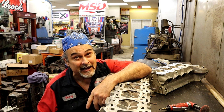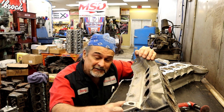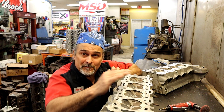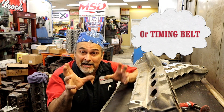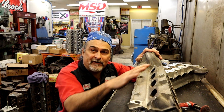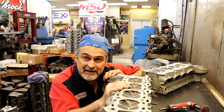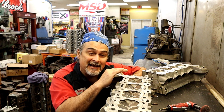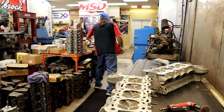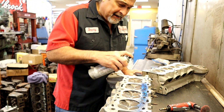This is a dual overhead cam head. There are bucket adjustments in here because it's not hydraulic. The more you cut here affects the top end. It has a chain — how are you going to retime the engine? Yes, you have variable cam timing, yes there are computers, it all affects everything. The point is you want to cut as little as possible off the deck. Get rid of the Scotch-Brite. I'll show you the cylinder head on the mill — we'll do a half-thousandth cut and you can see why Scotch-Brite isn't the thing to do.